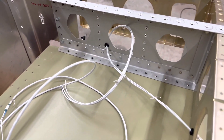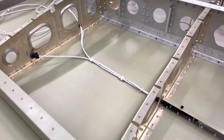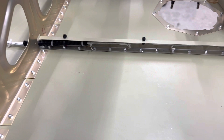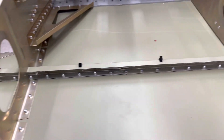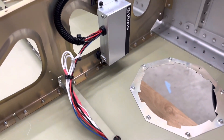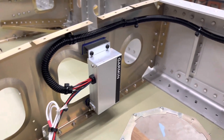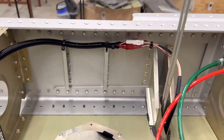I got the wires in place on the left wing. I used those little epoxy zip tie holders and got everything in that center C-channel secured. Then I did the pitot — that was a little bit of work to get all the wiring connections connected. I used basically the tip that Evan recommends for mounting the regulator: just a couple pieces of C-channel with some rivnuts.